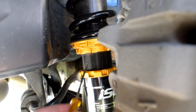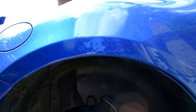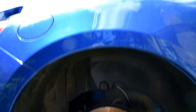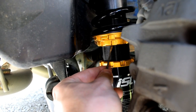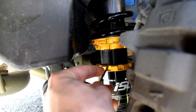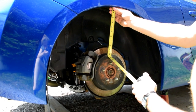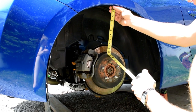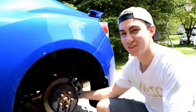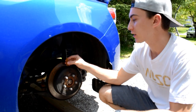Now when it comes to setting your ride heights, what I'm doing is coming in here and using this little screwdriver and just counting the threads all the way down, and then measuring the distance from the top of my fender to the top of this brake right here. Then I'm gonna go to the other side and make sure they both match up. So this side has 15 threads showing and it's just over 10 and a quarter gap here.